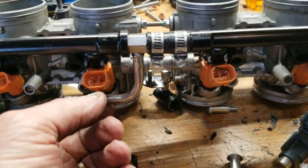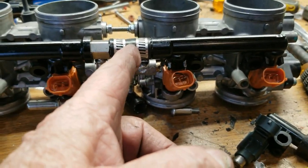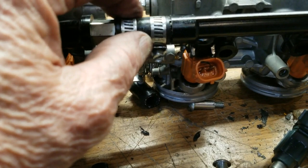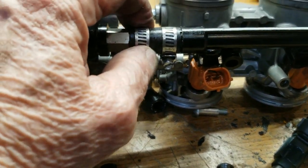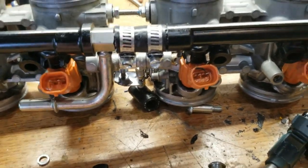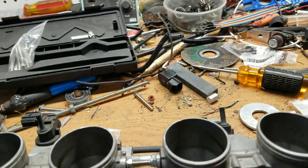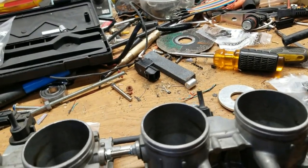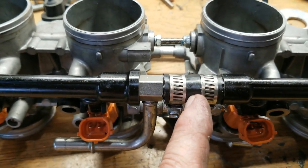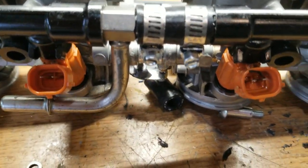This was a little more difficult than what I had anticipated. I was just planning on cutting this in the center and leaving half of it here and half of it over there. However, there wasn't enough left to put the clamp on and get a good bite. Luckily I had another old fuel rail fitting that I cut the entire piece off of and stuck it in here, and that bridged the gap. Now there's maybe an eighth of an inch between here and the end of this, so that should seal it up.